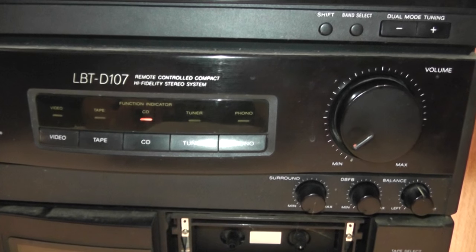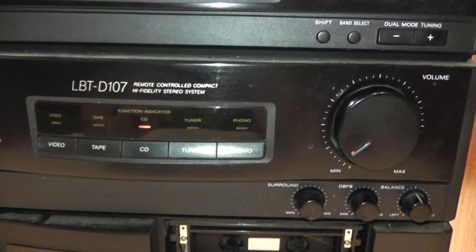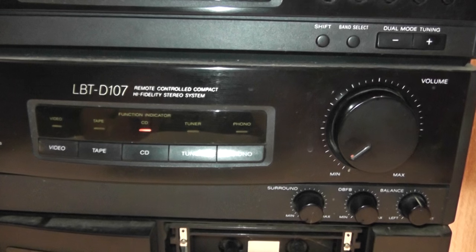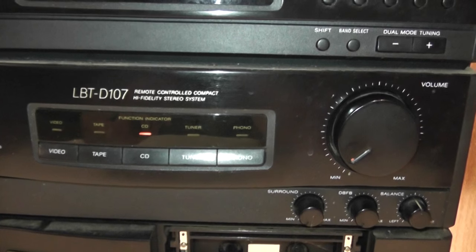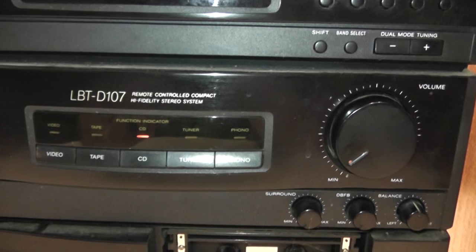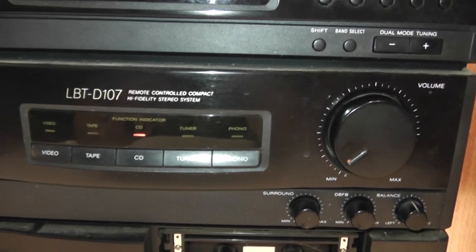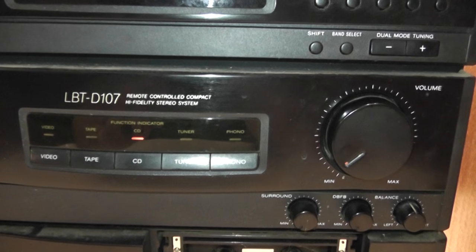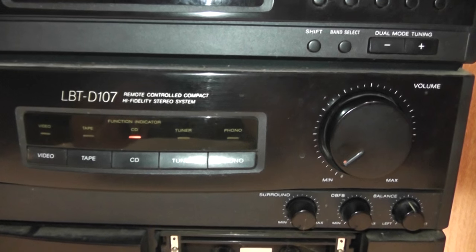The noise floor on this — probably due to the low power rating and the fact that the gain factor is not huge — but the noise floor is virtually non-existent on this amplifier. And don't ask me how I know this, but it is stable. It will stay on and run and play at 3 ohms per channel stereo. It will put off a lot of heat and probably not live very long like that, but I have tried it and it does work.